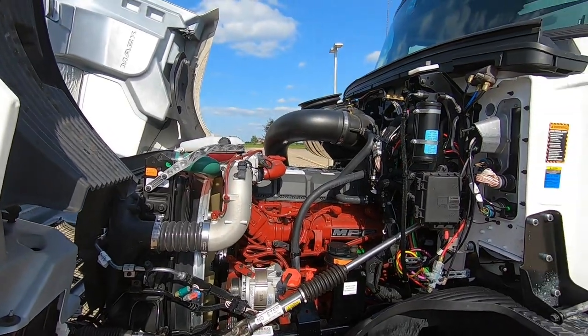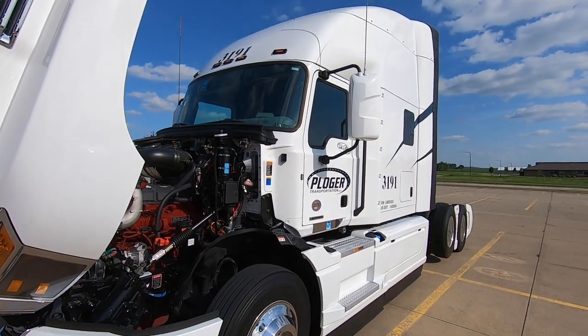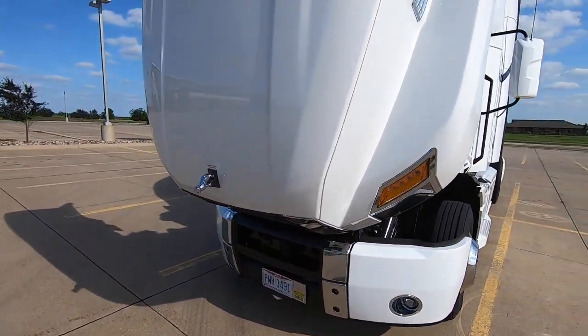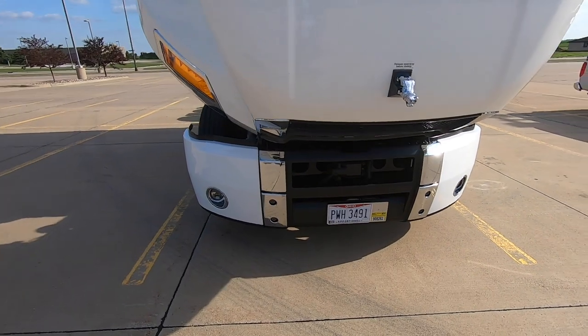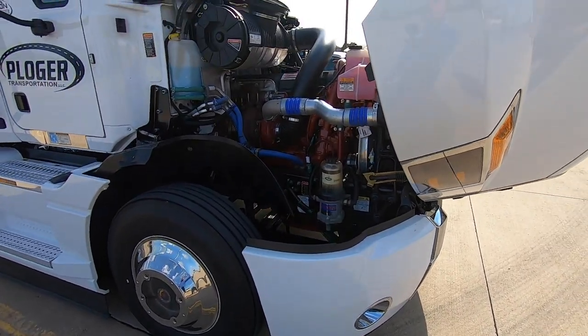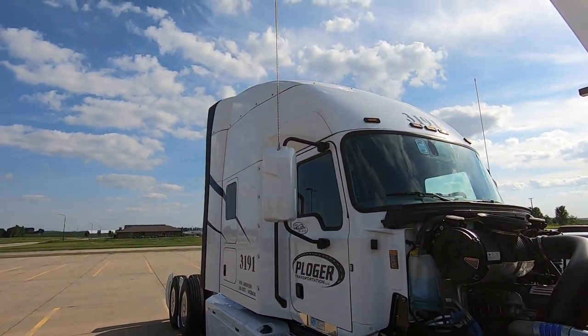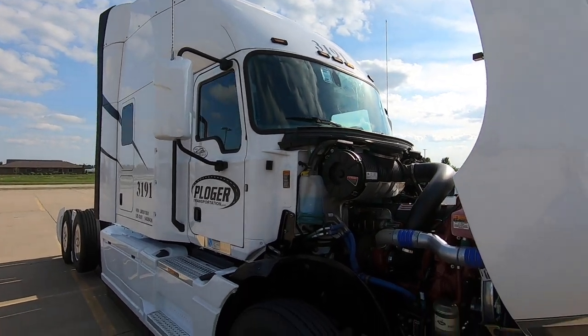We do a lot of experimentation with different types of fuel treatments, catalysts, and biodiesels, but straight number 2 diesel is still our preference. We do treat to make sure cetane levels are where they should be — the recommendation for Volvo Mack is 45, most pump fuel is around 40 and often degrades lower. Treating cetane also helps keep the fuel filters clean. We do 60,000-mile oil changes and we'll get fuel filters to last 60,000 miles if we treat religiously — it keeps asphalt from building up on filter elements. We're always willing to look at something though; I'm constantly testing in regards to fuel and fuel quality, always looking for that little advantage.